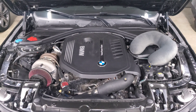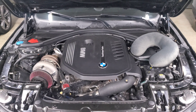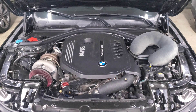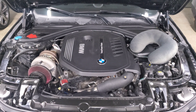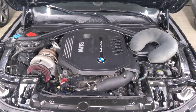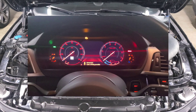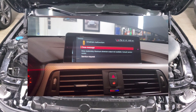If you are having an issue that requires calibrating the wastegate you will know it immediately, because it checks for the fully open and fully closed position as soon as you start the car. You don't even need to turn over the engine — if you just put it in accessory mode running off the battery, it'll run through that process to make sure the wastegate can find its open and closed position. If it can't do that, it'll throw a drivetrain malfunction.